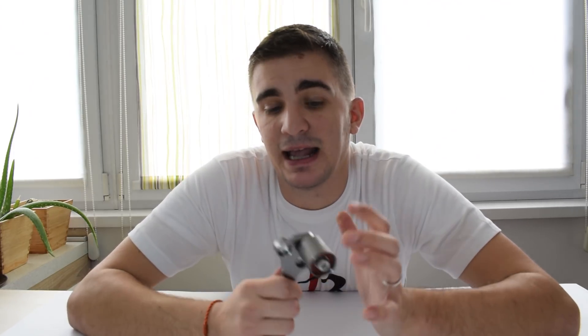So that's it for the unboxing and short review of this cool cam belt stabilizer from Manon Racing Products. To sum it all up: it will prevent your timing belt from flapping around, prevent it from ever skipping a tooth, and enable you to run your timing belt at its normal tension, prolonging both belt life and engine life. All very cool features I'm looking forward to having on my 4AG. It also has its roots in the N2 and Formula Atlantic race series, which makes it instantly cool and makes my 4AG a bike carb converted N2 wannabe engine — which is also kind of cool.